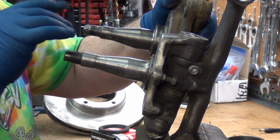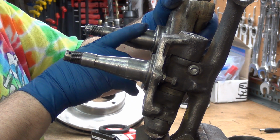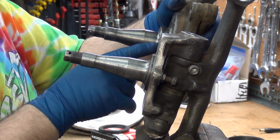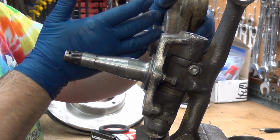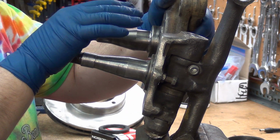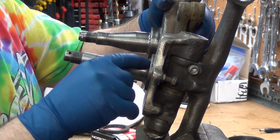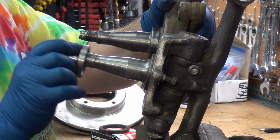hard body bearings. Okay, now the hubs, the Toyota hubs, when you do a 5-lug mod on a hard body, the hubs have to have the shelves machined in a little bit to narrow that gap between the bearings. You could go in and machine an 1/8 inch off the shelf on the spindle, but that means you got to take the spindle off the truck, send it in, and find somebody with a lathe big enough to swing it. It was just easier to machine the hubs. The difference being here is these are exactly the same length with that spacer on. So when you take that spacer off, it gives you some room to play.